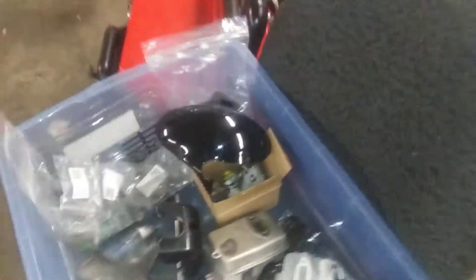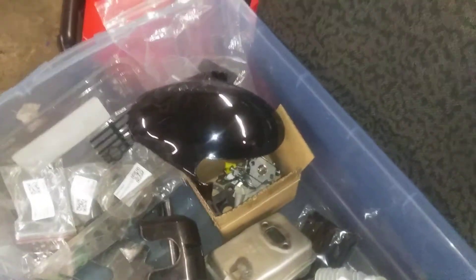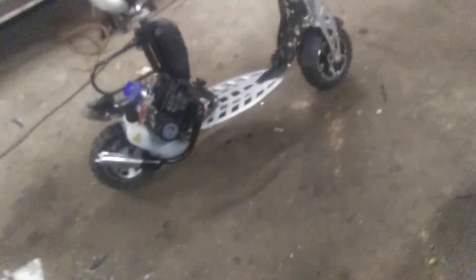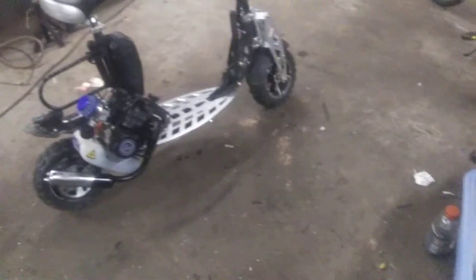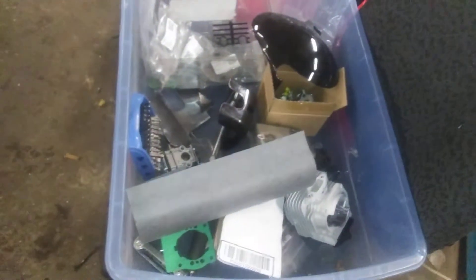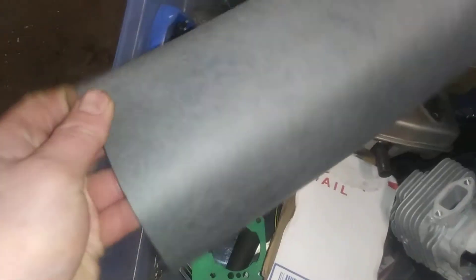How I made that head gasket: when I had the crankcase all ported, I put some paint on the top of the crankcase, laid the gasket material over the wet paint, pulled it up, and it made a perfect template of the gasket I needed to cut out. Cut it out with an exacto knife — worked out great. This gasket material is right around $10 and you get a lot of it.